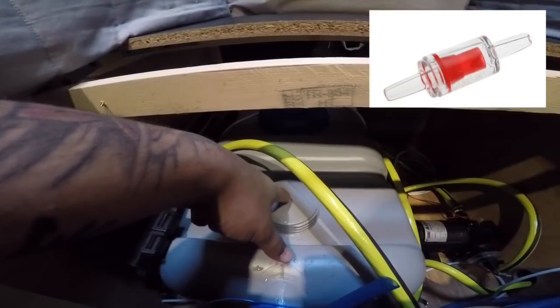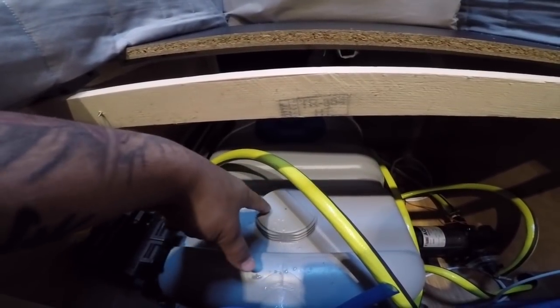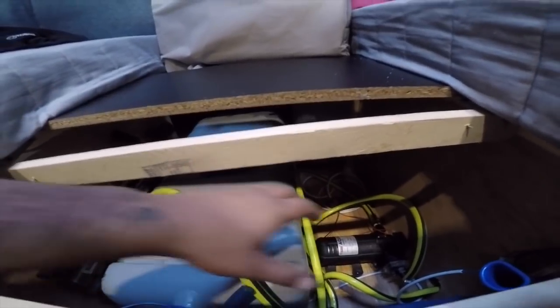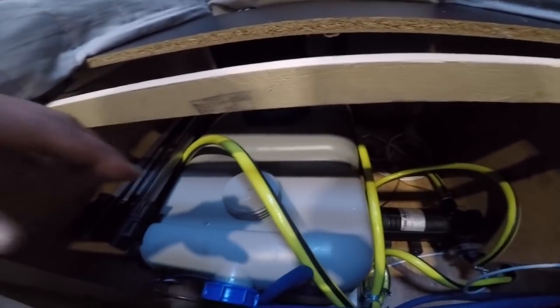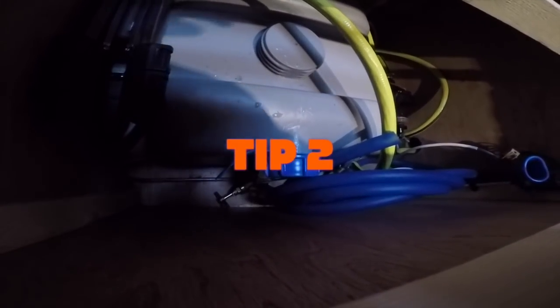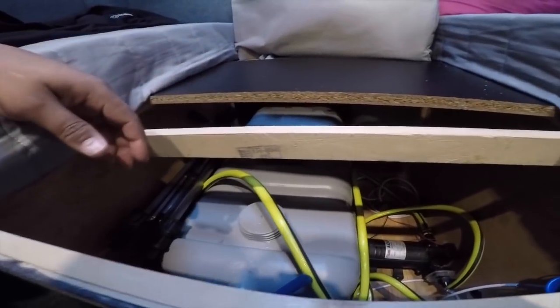Basically you put a tiny hole in it and then you put the breather hole so no water will splash around. A lot of people don't explain this. If you don't do this, when you've got your pump on, it will just keep drawing in and you'll knacker your pump, and you might even break your tank. And obviously I've upgraded it with a normal tap valve, because the plastic valves are crap, they just snap a lot. And that's about it on the tanks. I'm just explaining that because it will just suck in.